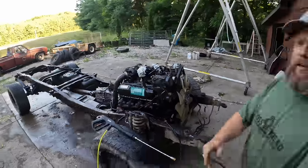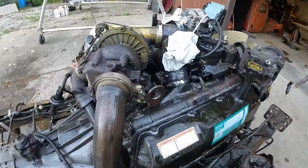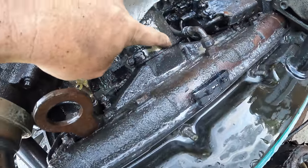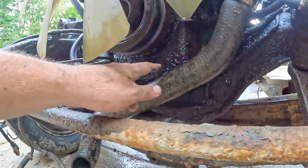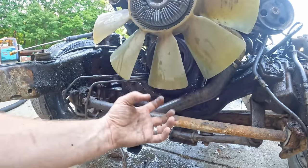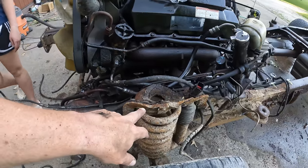Like most days around here, we're in a bit of a hurry so I kinda messed up — I should have got some before shots here, but we've got some degreaser blown in here on everything. You can just see how nasty all this is. You can at least see the condition of the front of the oil pan right here. The bottom of that oil pan is just flaking off — there's just rust flaking off of it and it's just seeping through, which was a known issue with these. So this is gonna be a problem here.